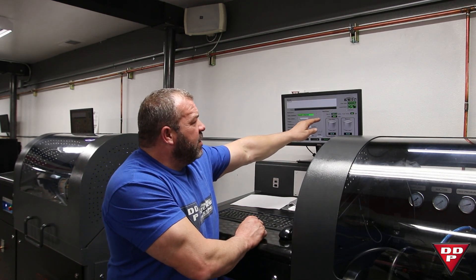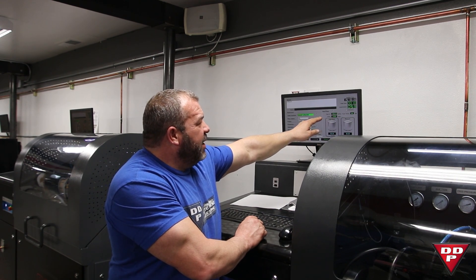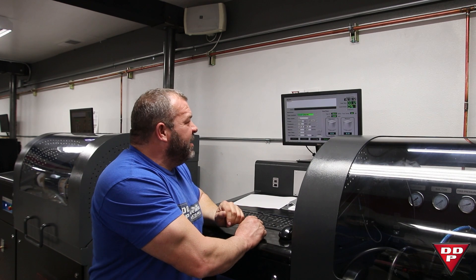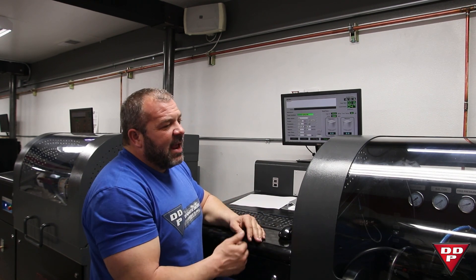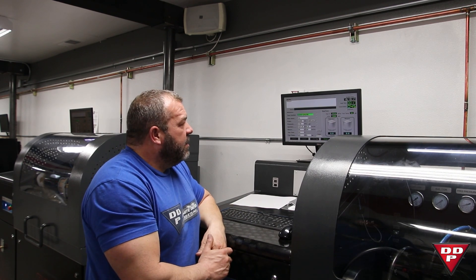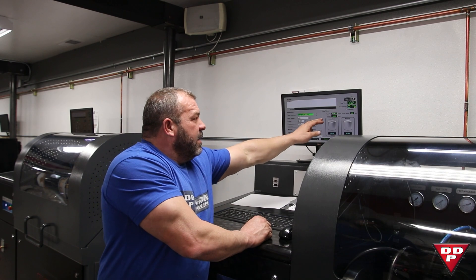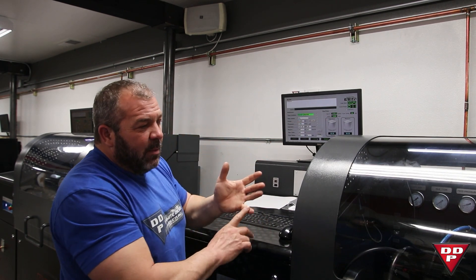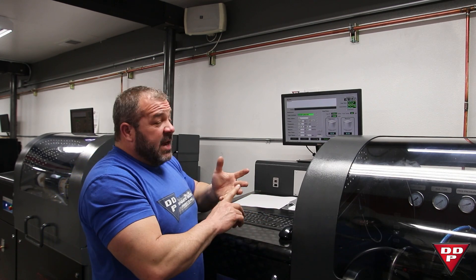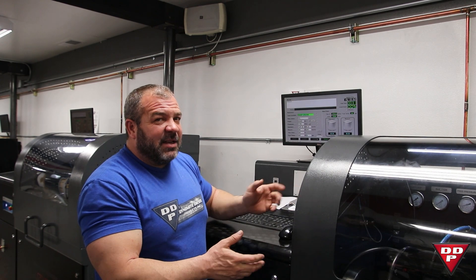Keep your eyes peeled on the rail pressure and pump RPM. We're desired at 175, we overshot it just a little bit and it's going to settle back down. Once we target it, it's got to bleed air out of the system and make sure that its rail pressure is very stable, or else we can't get consistent results.